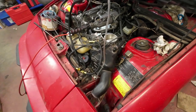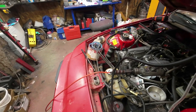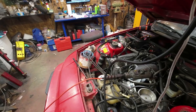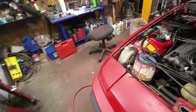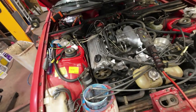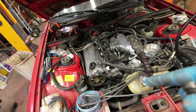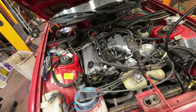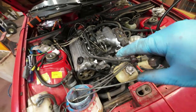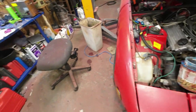Then the next thing it says to do is, like those injectors, when I turn on the electric fuel pump, these injectors should open, but they shouldn't open when it's just sitting like that at idle. Anyhow, I'll show you what I mean. Then it says to adjust that screw, the richness screw, until they start pumping out fuel, and then you back it off a turn or something like that. Anyhow, I'll read the instructions.